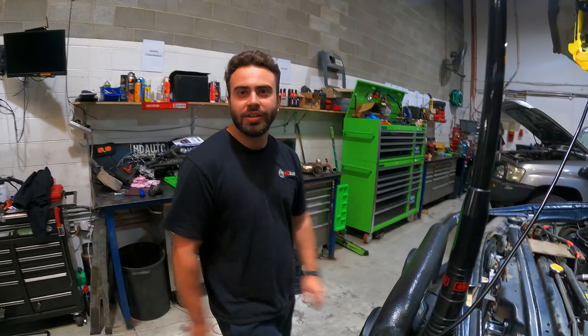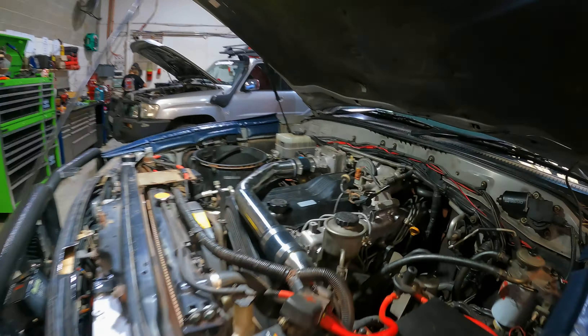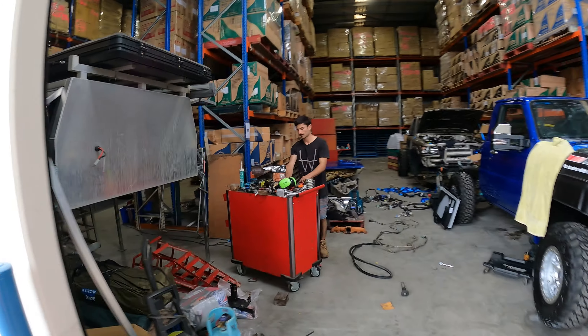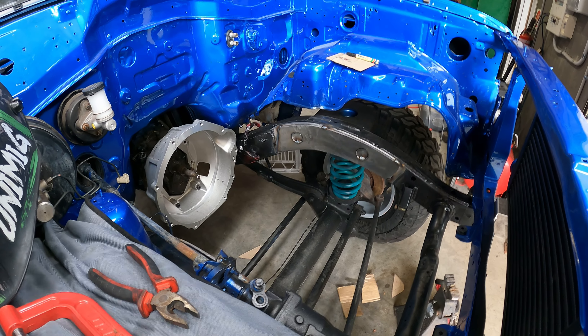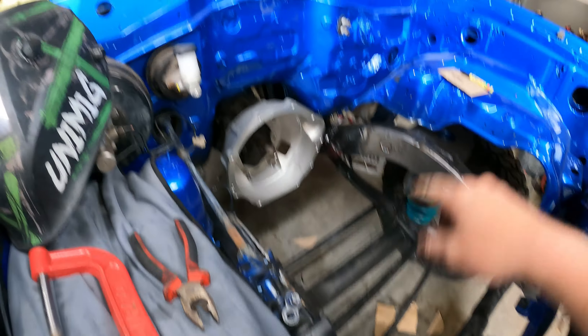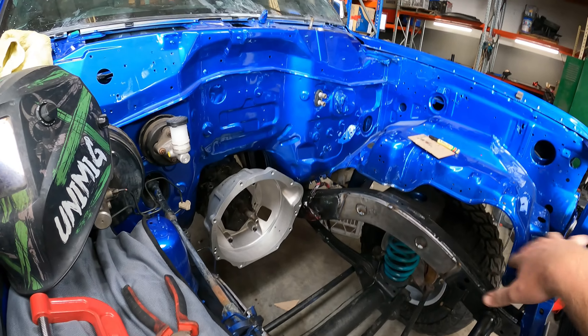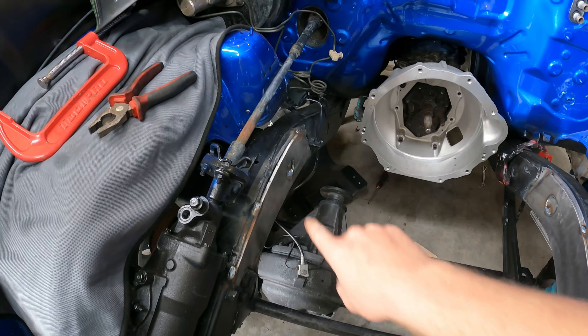More FTE goodness around here - this one's in for the full 270 horsepower package: injectors, turbo upgrade, intercooler upgrade, clutch upgrade, and unichip. That'll make a nice 270 horsepower, 700-750 newton metres at the wheels - nice and safe for towing a big van. You've walked in on a day when there's not a lot of FTE stuff happening - had a big week getting them out the door. FTEs and VDJs - that's what we're all about here.